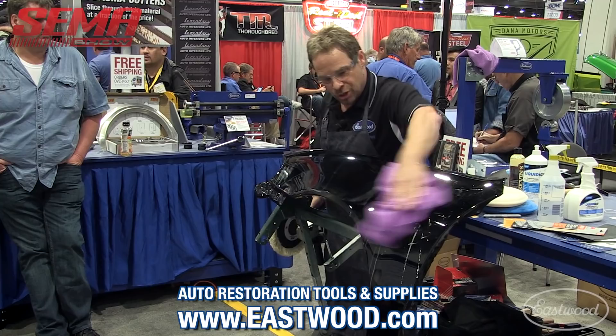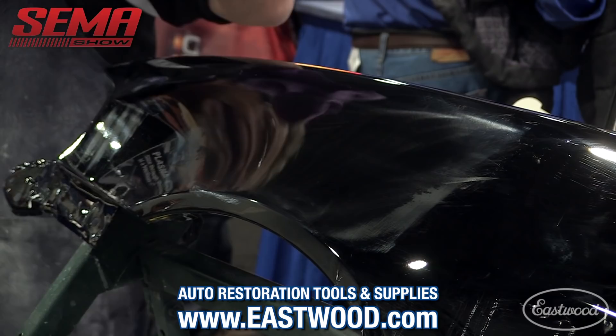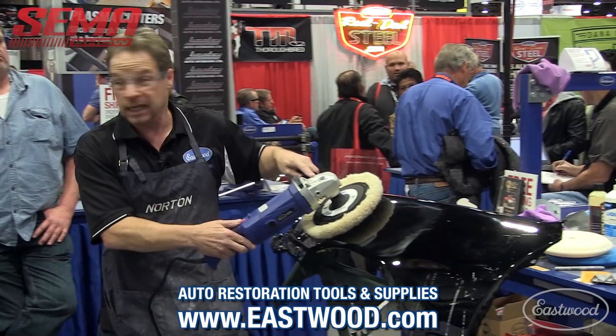In one pass and one application, I've almost reached full gloss — one pass, one application. And it's because I machined the surface to 5,000 grit in subsequent steps. I haven't removed too much material, I'm not going to buff down to the base coat. I'm going to give this another pass and we're going to rock and roll. I've just bought myself back some time and I like that.